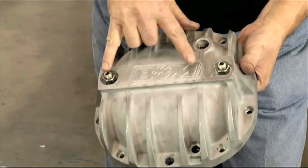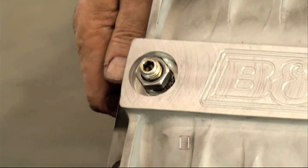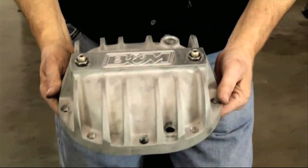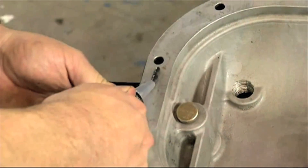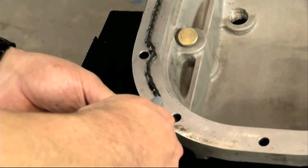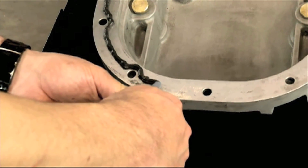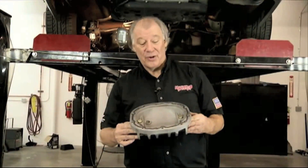The other nice thing is these two things right here. Tell me about those, Kenji. These are support bolts. What they do is hold the caps on the bearings in the back and keep things together for high-performance driving so nothing flexes. You adjust those after you've got it on. And of course you've got all these nice fins on here — this will help cool it. This is a class piece. One of the real keys is putting it on so it doesn't leak, and the key on that is to run a nice thin bead of black RTV right around here — one continuous bead all the way around. Don't put too much; you don't want it flowing inside. It's always nice to let that set for just a few minutes so it starts to firm up. That way when you put it on, you get a real nice seal.